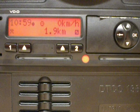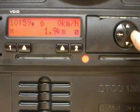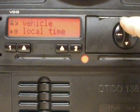When we get to the end of British Summer Time, we use the same process again to take the hour back off. Call up the main menu, press up four times, press OK, press up twice to reach local time, press OK, and at this point with the flashing time, we press the down arrow twice to take the hour back off, and then we press OK.